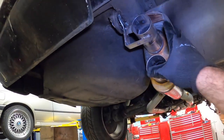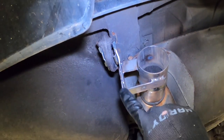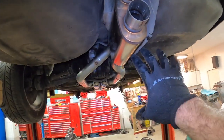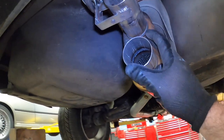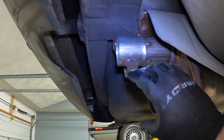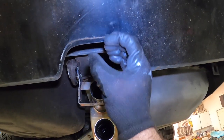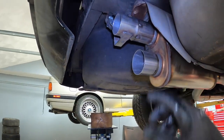Now that this is ready to go, I welded this piece up here and also another piece up here to prevent bending. The whole thing moves really nicely — it's very stout and doesn't hit anything, so it's literally floating on rubber mounts, which is exactly what we want. This guy is already tack welded in here. We need to cut this back because this guy is going to need to make a lot more of a swooping angle to get to the other side of the tailpipe — this guy comes around and that one comes up and over to the other side. So let's cut that and start making our bends.